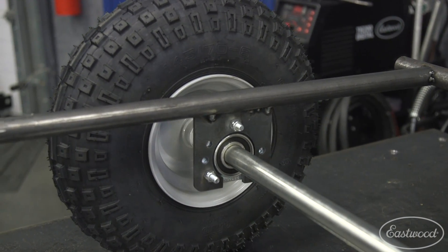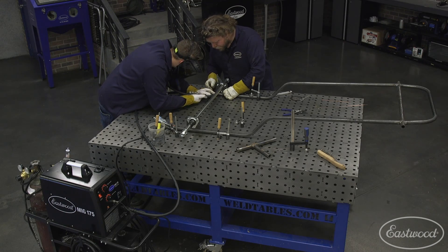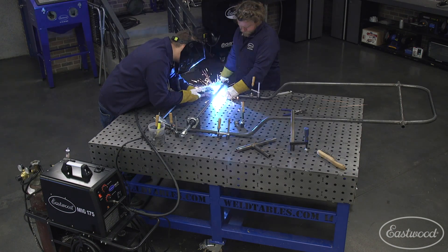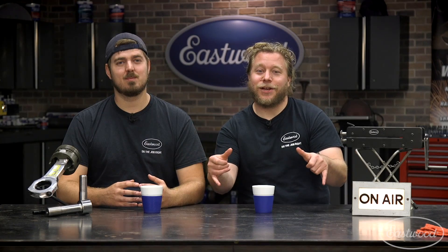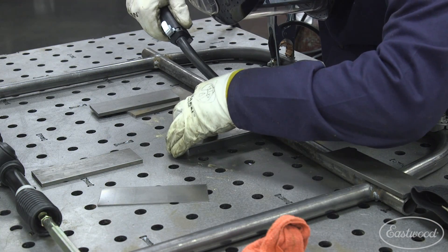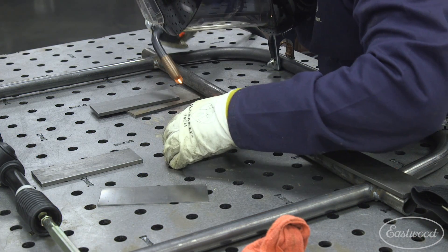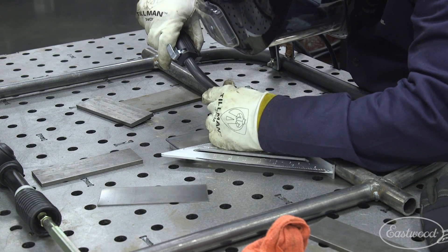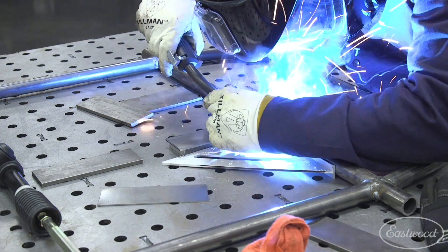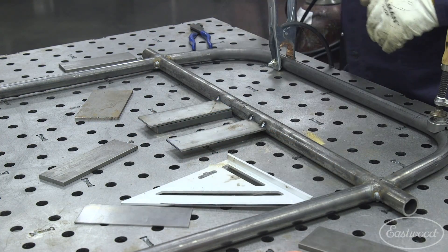We should also mention that last episode we tacked in the rear axle tabs — we just placed them on the rear part of the side frame rails, measured from rear forward, got our center points, and tacked them into place. To elaborate on the mounting system: the rack we got didn't have any bolt holes to hold it down, so we needed to fabricate something ourselves. The strap system gives us the ability to remove, service, or replace it later — just planning for the future.